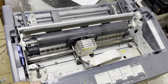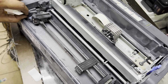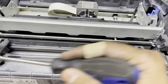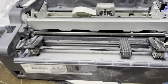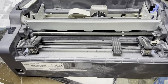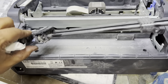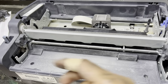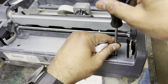There are four screws here. Before we unscrew those, we need to remove this part first because we cannot remove the top cover until this is out. To remove it, there is one place here and one place here — pull from both sides like this, then lift it up. It will come out smoothly from both sides. Be careful to remember the placement of each part you remove so you can fix them back.